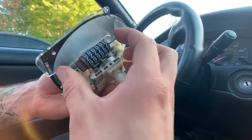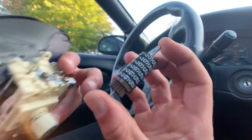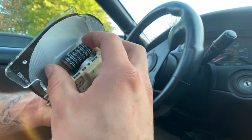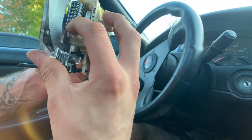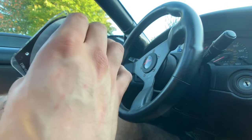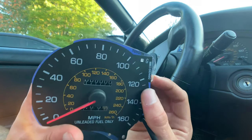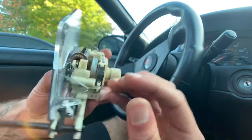Now bring it back into the odometer. You want to make sure these little teeth here are on the bottom so they're going to line up down here. This little gear here has to sit on that little noodle-looking thing — that little rotini noodle — because when that thing spins, it's what spins the gears. Drop this in here, make sure it's pointed down, make sure these gears are on there. Try to spin the gear a little bit; if it doesn't spin, that means you're lined up on those gears. Make sure it's perfect up and down, and on the front you see we have all zeros. The gear isn't spinning, which means it's in line with those teeth.